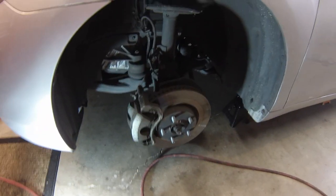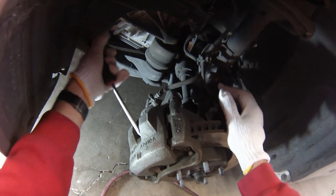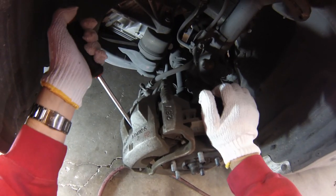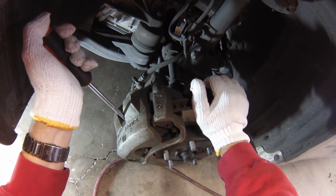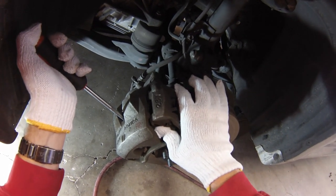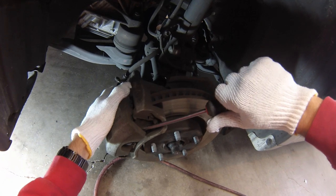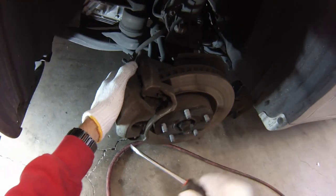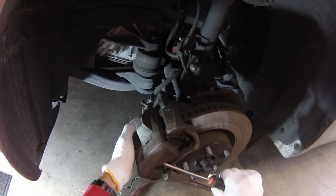We'll start with the front brakes first as it's the more simple of the two — there's no parking brake stuff to deal with. Before loosening any bolts, just stick a screwdriver in someplace convenient and pry the piston back into its space. I basically want to retract the piston fully so when we go to install the new pads we have sufficient clearance. I find it's easier to do it this way than to try to retract the piston once it's already off the car. Okay, so it's stopped moving, which means it's been retracted all the way.